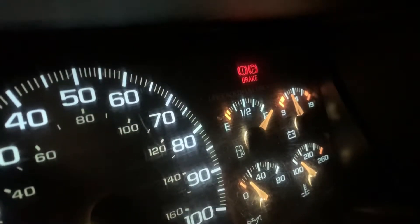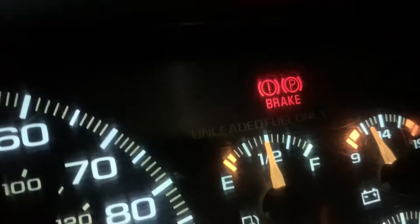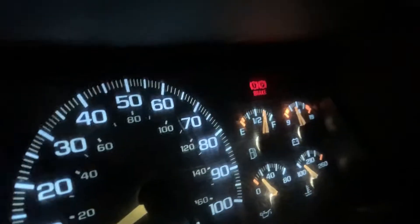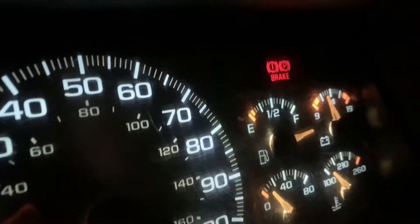Attach it to the door latch and watch that stepper motor — you want to see it go down to between a quarter and a half a tank or so. That's just because the bulb in the test light has some resistance in it. As you can see, it went back down to half, but as soon as I release, it jumps right back up to full and then past full. That means the stepper motor is working correctly.